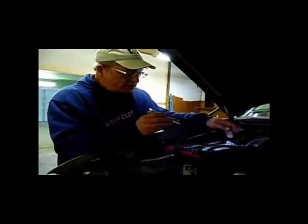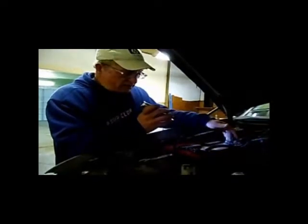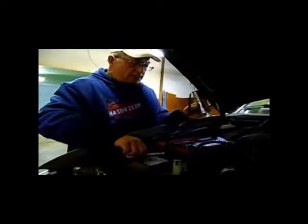But what we're going to turn our attention to is the negative cable here. And all it takes is, and this one is an 8 millimeter wrench, you just loosen it up, just a little bit like that. Then you take and you pull it off. Okay, so now the cable's been disconnected. Now you got to get it where it's not going to be reconnecting, because you will fry your jumper wire.